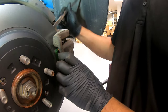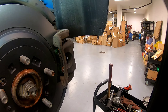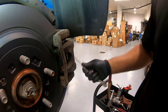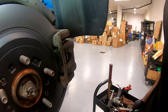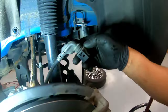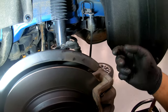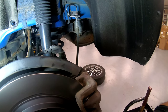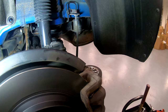Okay, tighten them up. You might ask why I don't torque this — I've been doing a lot of brakes so I know the feel, but the proper way is to torque it. I think the torque on this one is 24 foot-pounds. And don't forget your parking brake connector — heard a click, that's good. Now we're going to go back inside the car and do that brake pad change mode.